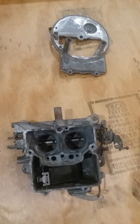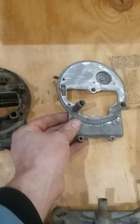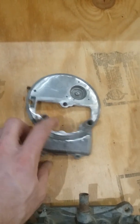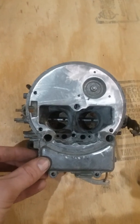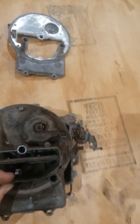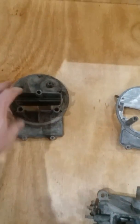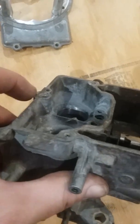A couple of little modifications I did — I'm redoing two of these for the 300 that I'm putting together. One is to get rid of the choke horn. You can see the difference: this one here is the factory one, this one here is the one that I've cut and modified. You can see how open it is. I left the bowl breather extensions on. I wouldn't recommend this on a daily driver where you're going to want to use the choke, but it does open it up quite a bit.